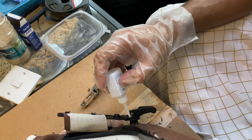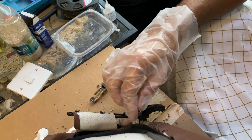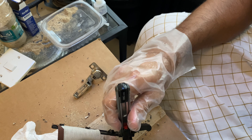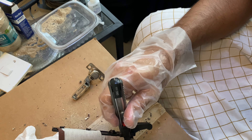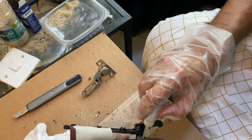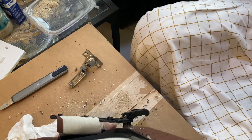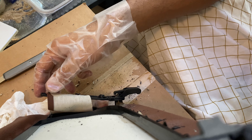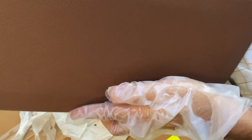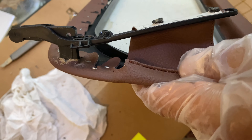When you apply the super glue in this area, make sure you wear transparent glasses or a face shield, because there will be fumes and smell coming out. I'm not sure if it's because of the sand and super glue or the plastic, but the fumes are really intense and may irritate your eyes and nose. And I don't have to tell you about gloves — when you play with glue it will stick to your skin, so make sure you have gloves.